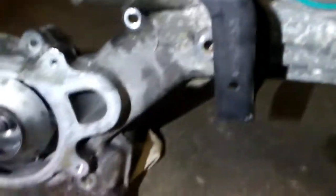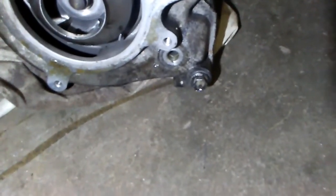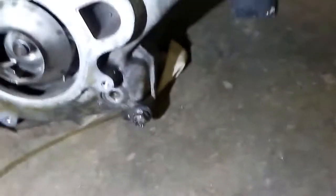But yeah, these bolts down here, two lower in that corner on that unit, and then you got these upper ones here. Them ones you can leave out till you're basically all done. It doesn't matter. But these other ones in the bottom corners, when you go back together, you're going to have to leave them in there, because if not, there's going to be no way to put them in. The transmission is in the way. Like I said, I couldn't take them out. I had to gear wrench them, back them off, and then basically try to pull them with the unit. Once I got the unit loose, I angled it, and then I slid two other ones out of it, because they were catching on wiring.